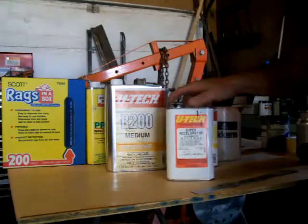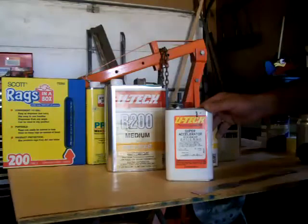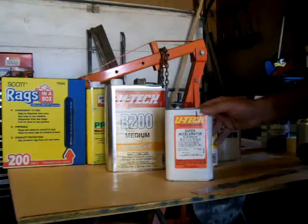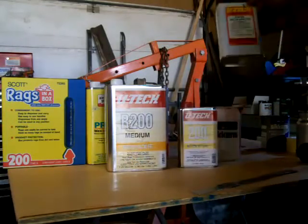If it's cooler, I like to just put a little bit of accelerator. It just locks up the film a little more. If you get too carried away with this on a hot day, it'll dull your finish back. But in case you have to do a recoat or just to firm things up a little more, a little bit of this doesn't really hurt. I always keep some on hand. It's kind of nice to work with.